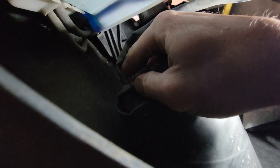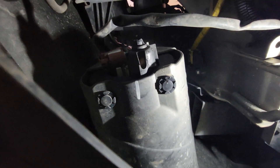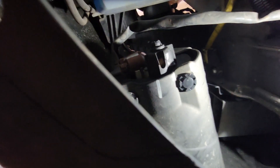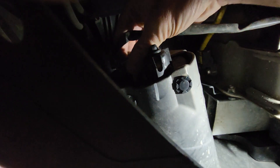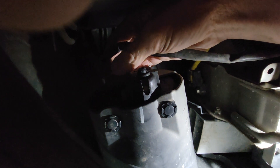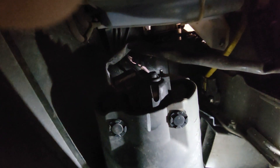This is part of the fender liner, so we're going to pull it back and the access to the bulb is right in there. The actual bulb is right here — it's just going to be a twist and pull and it has a connector right there. You're going to push it in, pull the connector off, and then pull the bulb out. If you have small hands, no need to remove all this. The bulb is just right here — you'll be able to twist it and pull it out, then disconnect it.